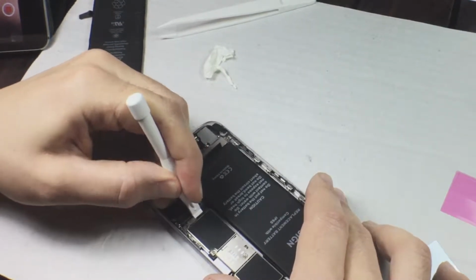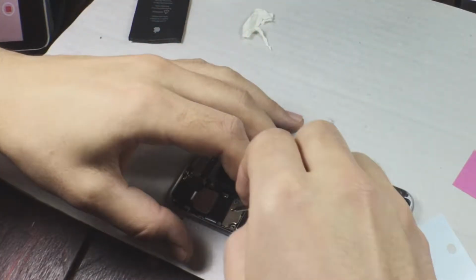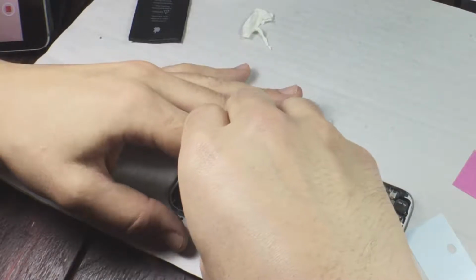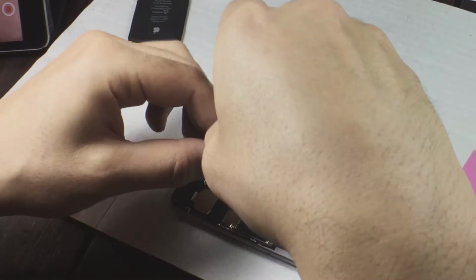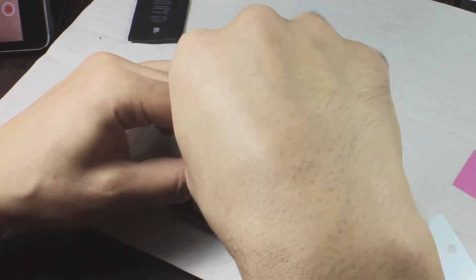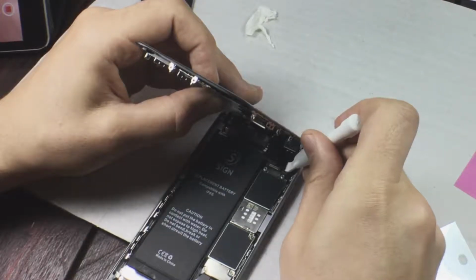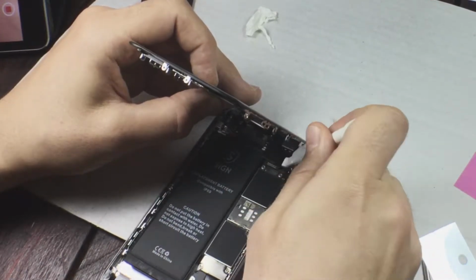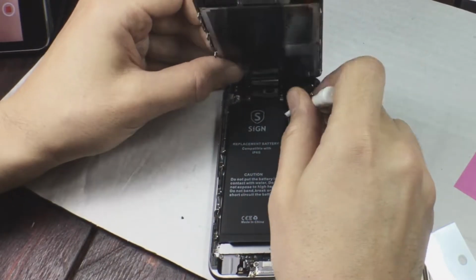Okay, so when you put that down, you screw down the metal, and then you need to get the screen back. So you need to get the screen connectors back, and there's an order to these, but it's easy to find the order because the connectors are placed on top of each other in a certain way. You just plop them in there. Just make sure you press on each connector. There's like a snapping feeling to them when they actually plop in there right. Press on them with the prying tool.